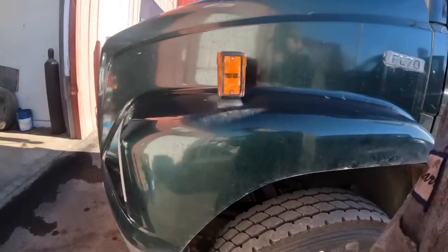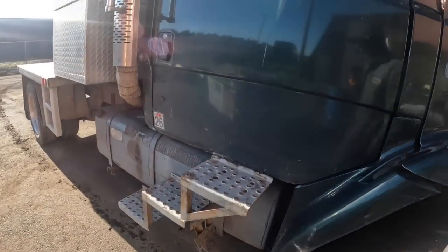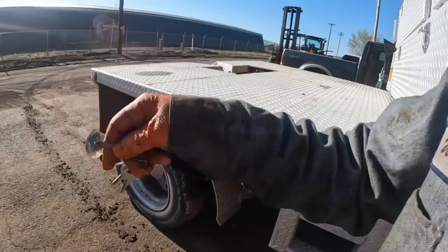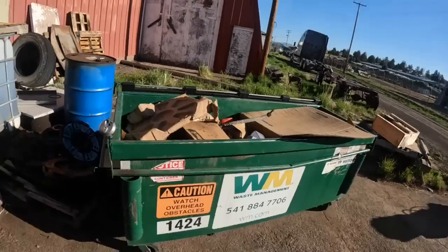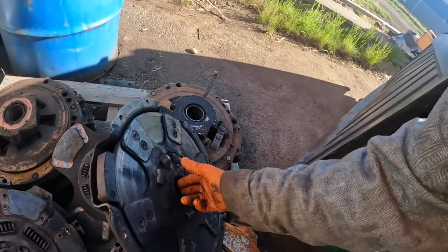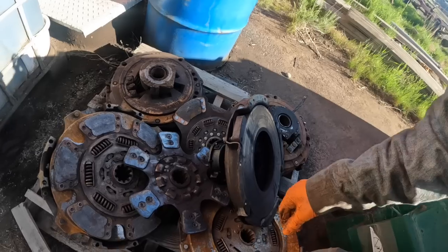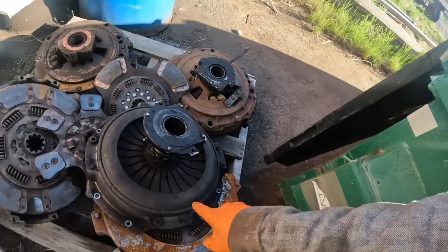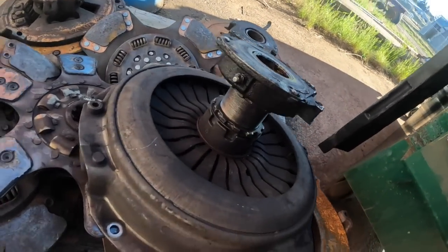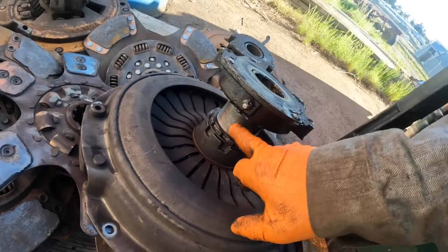I put a clutch in it, and when I got into it I noticed it was riding really rough. It must have been sitting for quite a while, because I couldn't get the air suspension to raise up with the switch in the cab. I finally pulled the leveling valve arm off and just ran it up and down, then it aired right up. But somebody had a single disc clutch in there — look at this goofy clutch. It must have been factory, but it's just a single disc clutch and it was completely gone. The reason it was gone is because the clutch fingers were flat. Those should be arced up to put spring tension on that pressure plate, but they're flat. It's almost like a pickup clutch. Weird setup — never seen one like this.